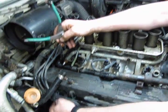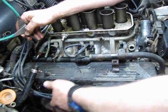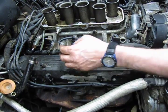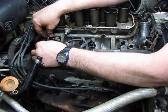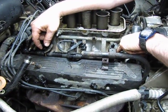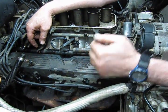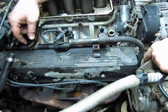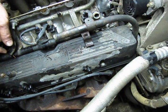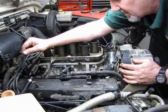We've uncoupled our spark plug wires from the harness looms down the end. There's no screws or anything else to be disassembled from the bottom. And just as we did on the left side, we're going to have to lift the harness to access the upper bolts, and in this case we're also going to have to disconnect this front bolt, which will allow us to move this tube slightly up and out of the way. There is a bracket down below with a bolt on it that also holds this in place, but that bracket is bendable, which we're going to have to do, otherwise you'll be removing the AC compressor, the alternator, and the mounting bracket just to get to that bolt. We'll show you that in just a minute.